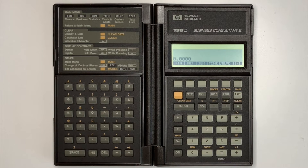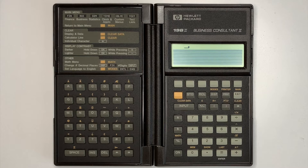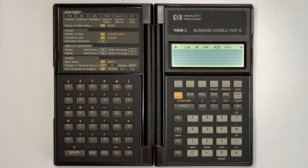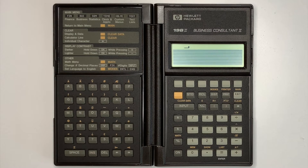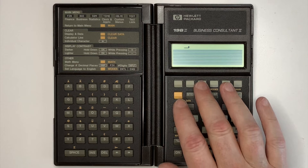The calculator self-test is accessed by pressing the fifth soft key under the display and then the on key simultaneously. The self-test performs various display and system tests, displays the status, and then repeats until interrupted by pressing the third soft key and the on key simultaneously. If you have a supported infrared printer in range, the self-test also test prints a few numbers.